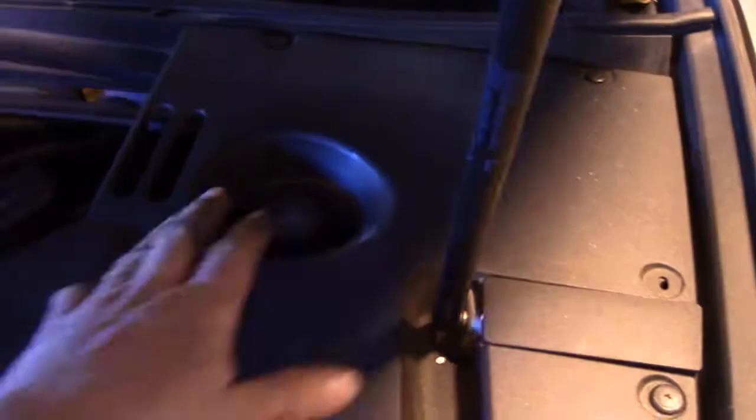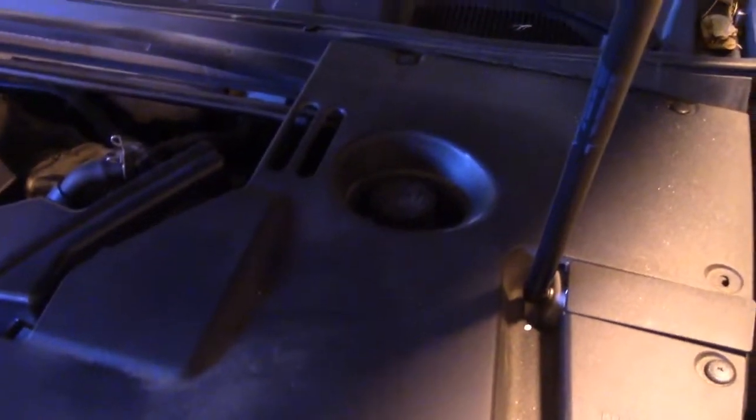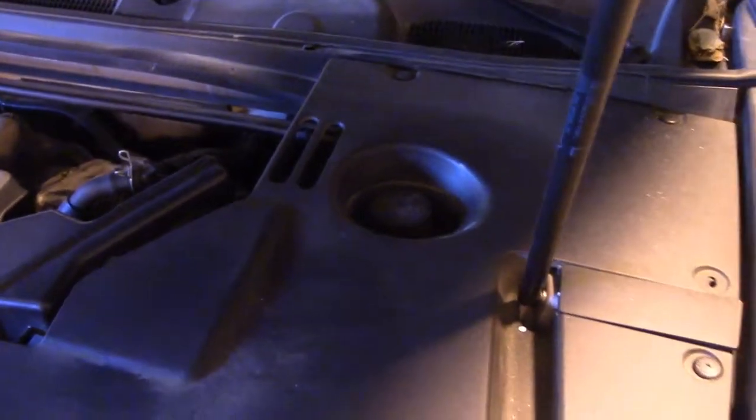Brake fluid is at the exact right level. We put the cap to our master cylinder back on. I just can't stress enough to make sure you come up with some way of remembering to do that. Now, all that's left is putting the wheel back on and taking it for a test drive.